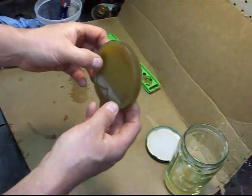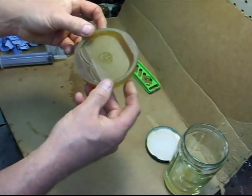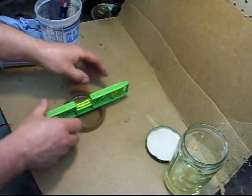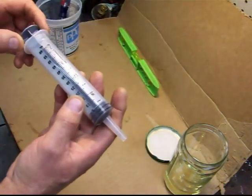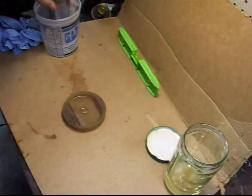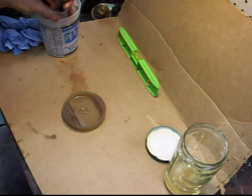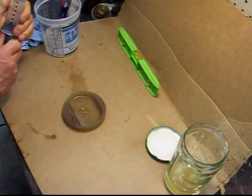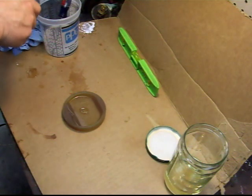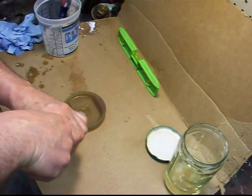This is the resin mold off of the stock piston I just created. What we're going to do is see how many cc's of water it holds — I'm going to get it level. I've got a graduated syringe and my soapy water here. I'm going to fill this up and get any air out of it. I want to pump out the water until I'm right at 60 cc's, then go ahead and fill this up until it's level.